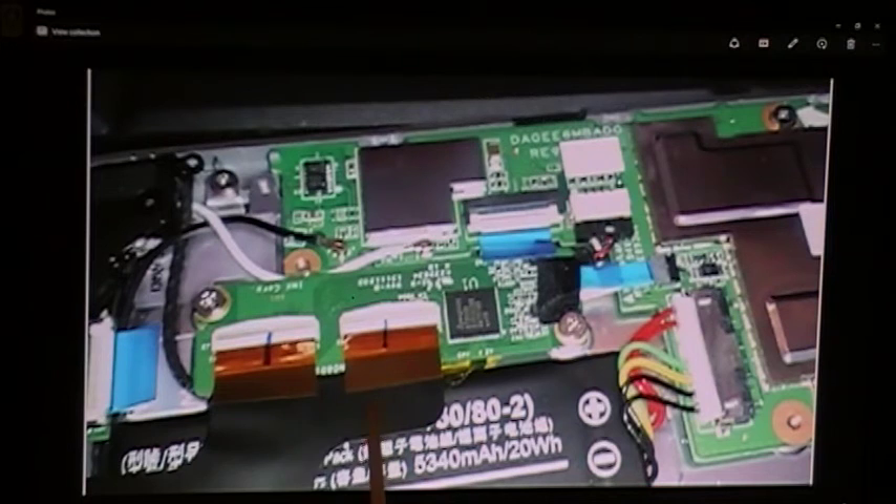Then this is your flat flex cable that goes to this circuit board, which has your touch screen CPU on it. There's a flip switch on each one of those connections. If you take your fingernail and just flip it upward it will release those cables — you can pull them out pretty easily. Once those two cables are out, I just put them back in. The brown part here is a tab you can actually grab hold of; I use that to push the tab in a little bit farther, then I flip the levers back down.